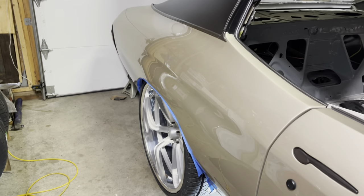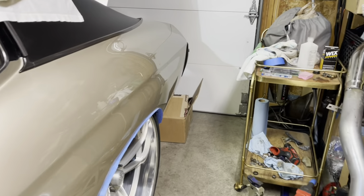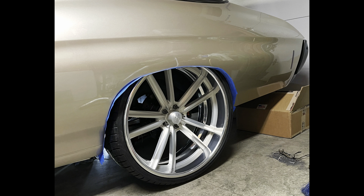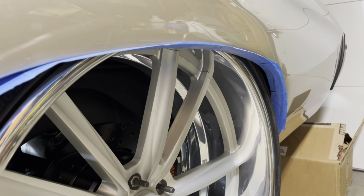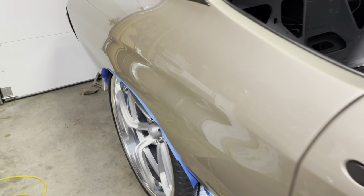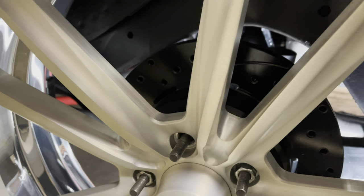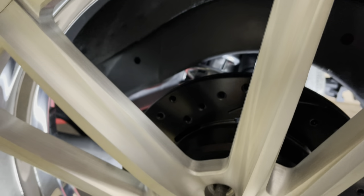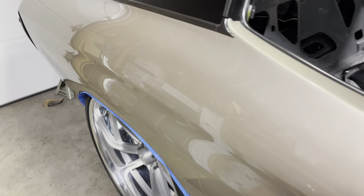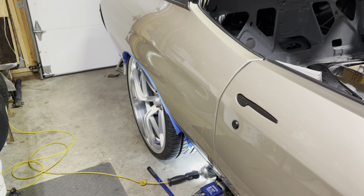I'm sorry y'all, I'm just tired — I've been out here so long. I'll post a picture of this thing squatted at its lowest — it was so low, obviously can't ride like that. It's in there and it seems to be doing the job. The trick I got from a guy on YouTube of marking the midline of the shock works perfectly — I can use it as a gauge to see where the shock is riding.